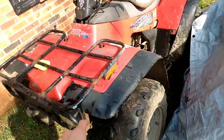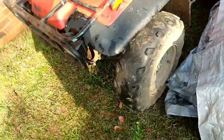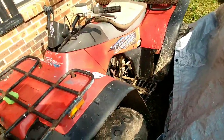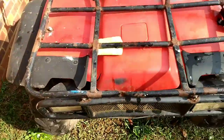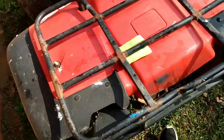Alright, so this is my 2000 Arctic Cat 300, little two-wheel drive. Honestly this is more for hunting purposes than anything. We've got this tarp right here that we leave covered over it because these things have bad problems with water getting into this little part right here, getting into the gas tank — then you have to pull your carburetor off and drain your gas. We also got this right here because the plastic likes to rattle and it's loose because the person who put it on didn't put it on right.